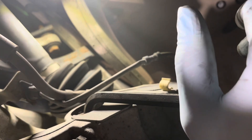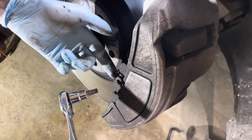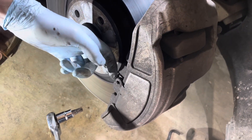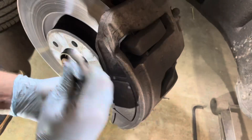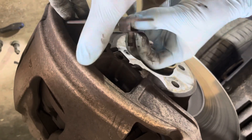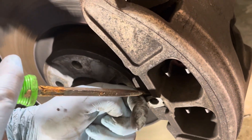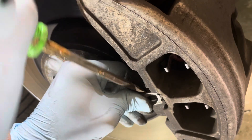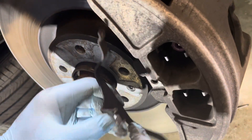This fits in here. Now a 9mm hex is a bit harder to find — I'll take those out. There's a T45 bolt right on the front of the caliper, and this has a dust shield right here but also the caliper spring. I'll take a screwdriver right in here where the bolt is and push the spring out in this direction, because it's held in with these little forks that go into the caliper.